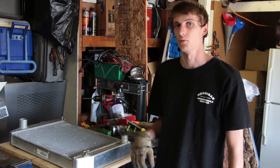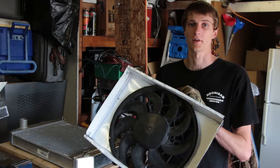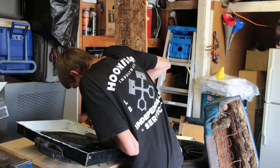I got the radiator up on the table so that we can test fit our shroud and fan. The fan is all mounted in the shroud off camera, but our shroud is pretty much done. So now we're just going to drill a couple of mounting holes on the shroud and the radiator, mount this up, and throw it all back in the car.